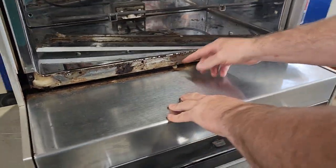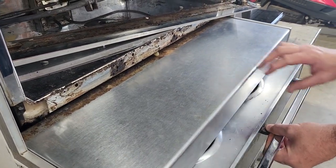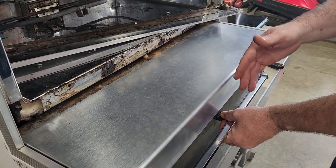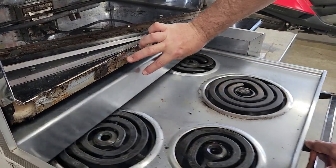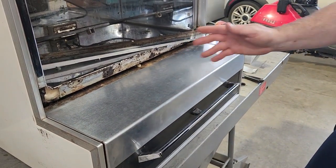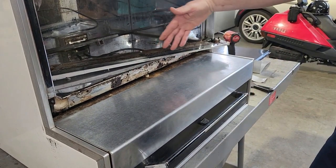Now, when you open it, if this was on, no, the drawer cannot come out, but the drawer will, with the spring, slide back in and then come on back out like this. We don't have the spring attached, so when I pull this, the drawer stays, but the spring will slide the drawer back, and then the catch will slide the drawer forward. So that's how the drawer works. It just hooks over those, with spring pressure to pull the drawer back.